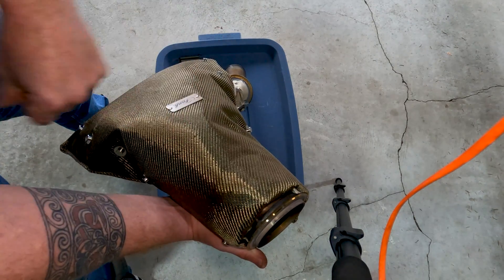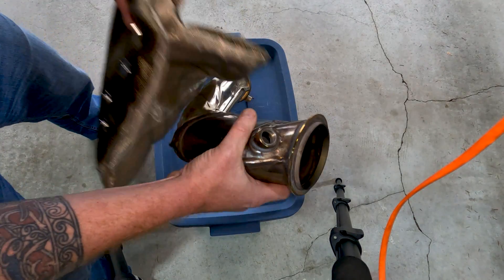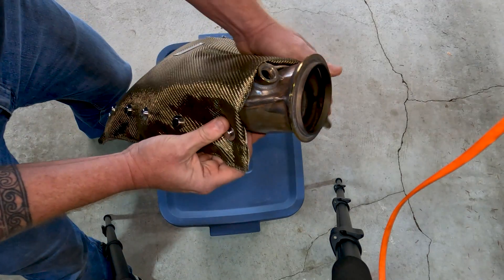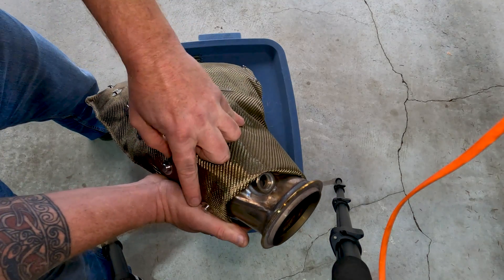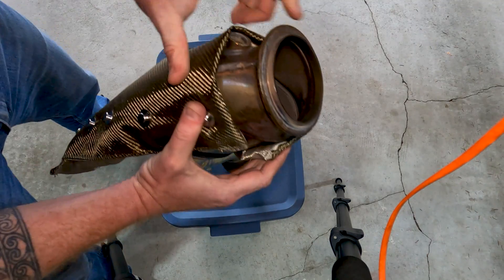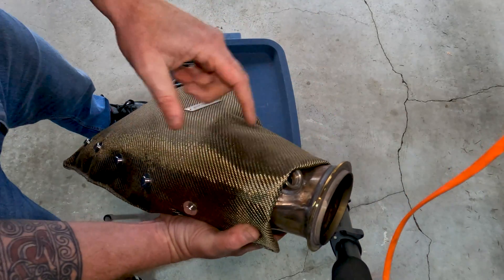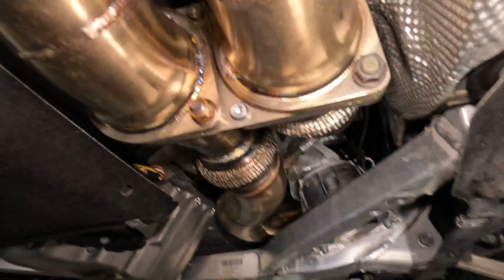The other way is to slide the blanket up into place, which is what I'm going to do. When we're back underneath the car, I'm going to feed the blanket up and around the downpipe itself, getting it around the O2 sensor as best I can, then use springs to pull the blanket down tight and hold it in place. It doesn't fully close right at the moment because this is a four-inch blanket for a four-inch pipe, and this downpipe is bigger than that — but that's going to be the best way to fit it in. Here we are back underneath the car.